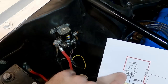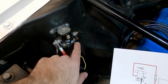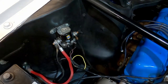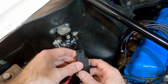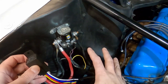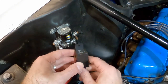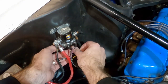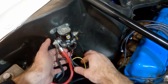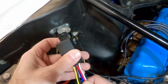The way this is set up in this drawing, it's more or less the same thing. We're going to want to use this terminal right here and this terminal on this side. When we turn the key on the car, this terminal becomes active and that's what we're going to want to use. We're going to mount the relay somewhere near the starter relay. You can put it anywhere you want, but I like to put it next to this stuff partly because we're going to have a lot of wires right here, and then I'm only going to run one wire to the electric choke itself. If I mount it underneath here, it tucks it away and keeps everything clean. So this is where I'm going to put this relay — I can drill a hole in the fender here for that mounting screw, and then we can get this harness prepped for the wiring.